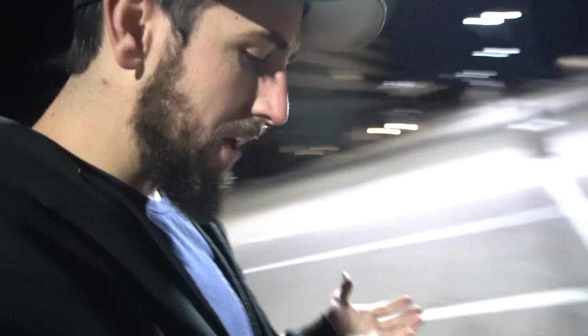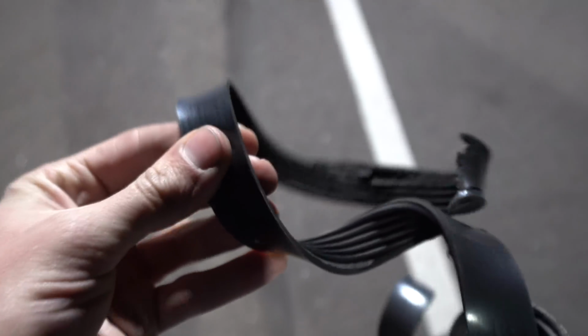So the issue is a 100 amp alternator on a 200 amp system, electric power steering, all that type of stuff, 2 big giant fuel pumps, a bunch of electronics in this car that this JZ alternator basically wasn't up to. I'm not sure if it locked up. Obviously something got really, really hot and basically smoked this belt right here.